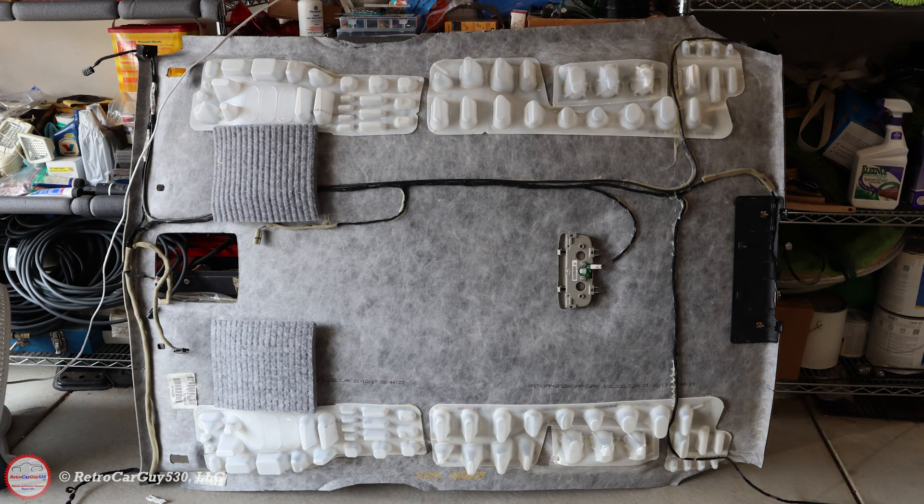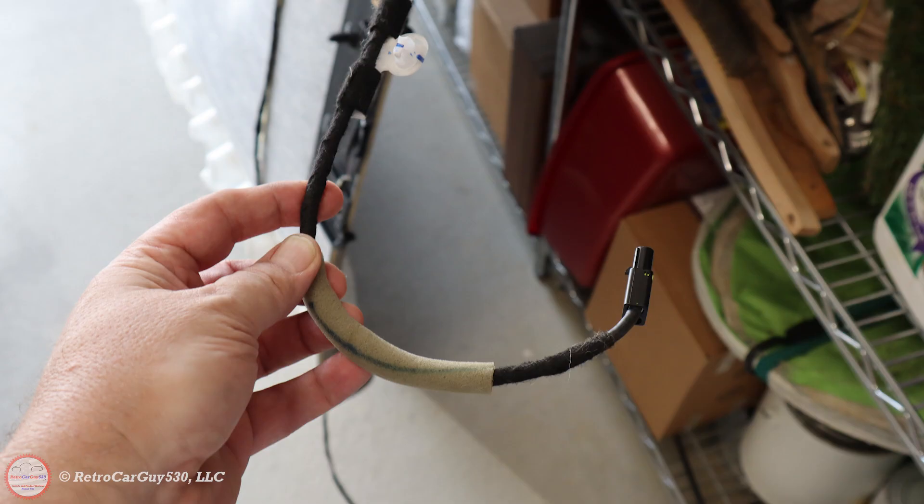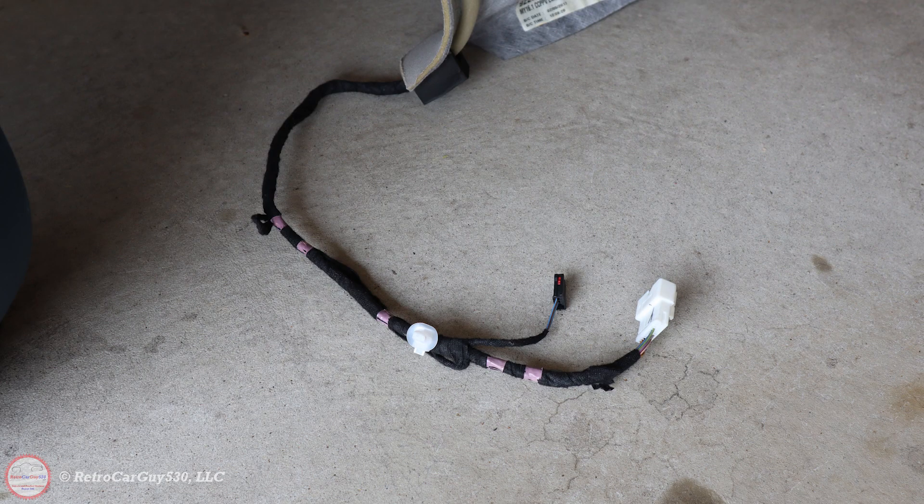Here's the replacement headliner. Without those four foam pads, I transfer them over from the original headliner using a hot glue gun to adhere them. On the front right we have two cables — one that's not clearly in picture is to the tweeter in the A-pillar trim panel. On the C-pillar area on the right rear we have a cable that comes out and connects pretty easily. On the front left we have the tweeter connector again for the A-pillar trim panel, and then that white connector that clicks — be careful with that retention clip.